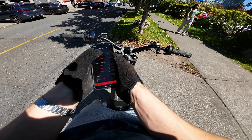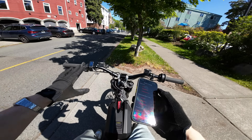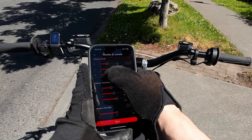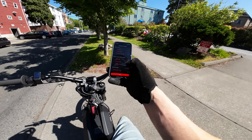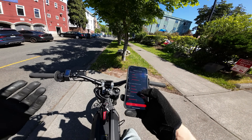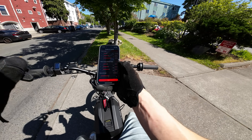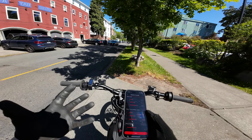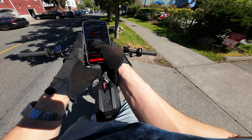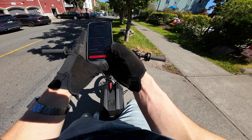I'm making some changes in the app. Mode one becomes beginner mode at 5.6 kilowatts — for when a first-time rider gets on the bike. Mode two is my daily ride at 10 kilowatts, which is kind of perfect for wheelies with a bit more range. Mode three stays at 15 kilowatts full beans. Phase amps: mode one is 250, mode two is 450, mode three is 600 max. Reverse strength set to 50.